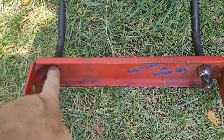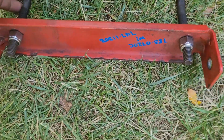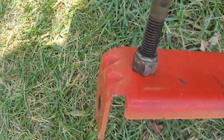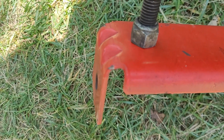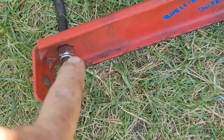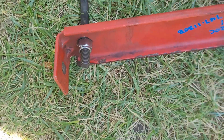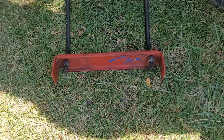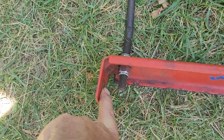They didn't come with the other nuts, so I put in some good stainless, the ones with the nylock. I put their old nylocks, you're not really supposed to reuse them, but I put their ones on the inside. If they come loose, they'll just back off. The pressure is in the pulling direction, and of course you wouldn't want to have that thing come loose. So I put the newest ones on that side. That part hangs on the tractor with a pin, which we have to make. And the other part, the deck, just hangs right on that.